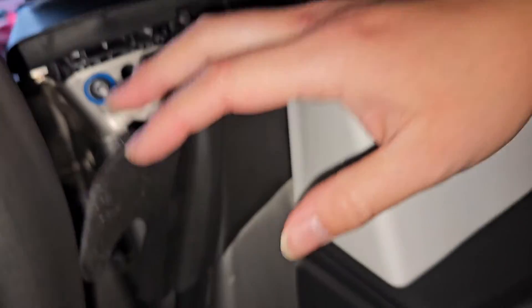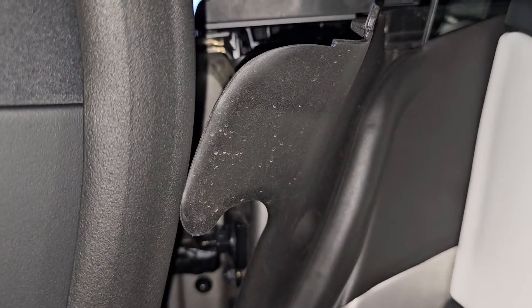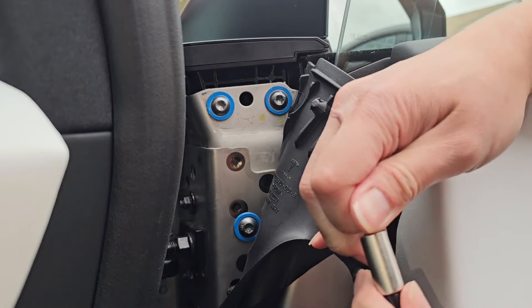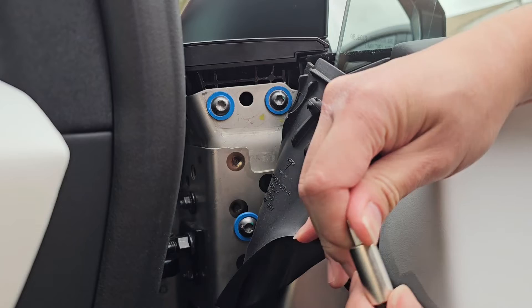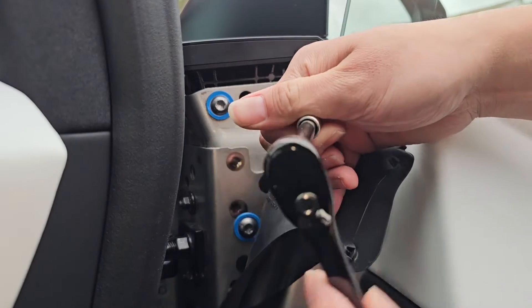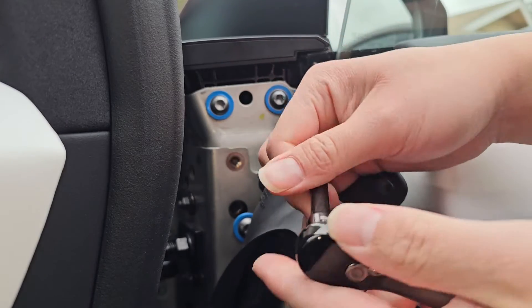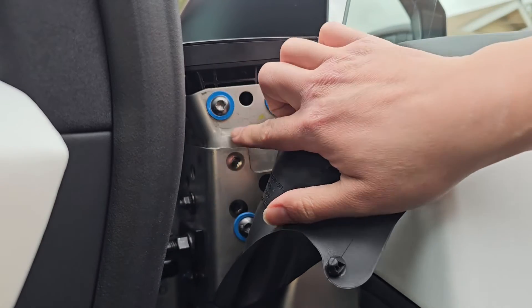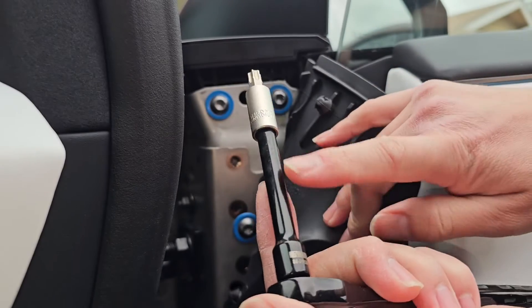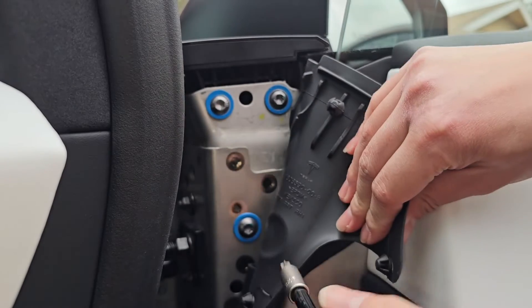We're gonna need to go get the tool for this — I believe it's a T30 or T40. So what you're gonna need is a T40, or Torx 40. It's okay if you have the security one, that works fine. And then you're gonna need one of these ratchets, because if you just use a screwdriver, these are super tight with these little blue washers. If you have a bigger one you can use that. I also have an extension here. Basically you just want to get it started — once you can kind of turn it, you're okay.